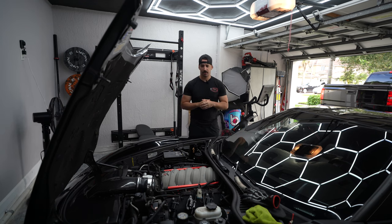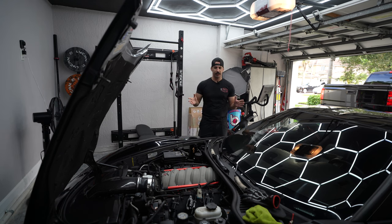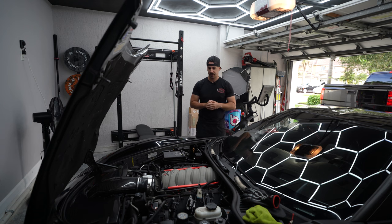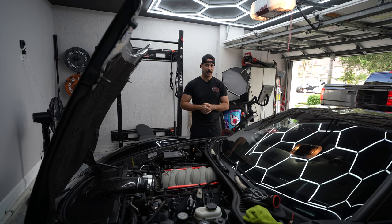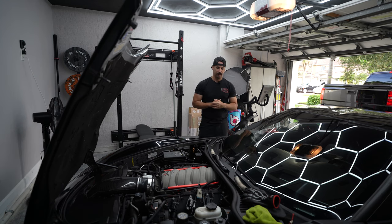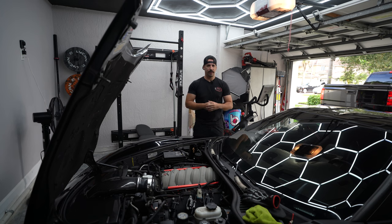This time I decide to look at my gauges. My temperature's spiking — I'm at 230 at that point, and by the time I pull away from the stop sign I'm close to 250. I turn the car off immediately because we obviously have an overheating concern. I let the car cool down and bring it back home — not even half a mile from the house. First thing I check, once the car's cooled down, is how much coolant I have: zilch in my reservoir. The car had this weird issue where on first startup it would spit out rusty water I kept finding on the ground. I initially thought it was condensation from the exhaust pipes, but it was too large an amount to be just moisture.